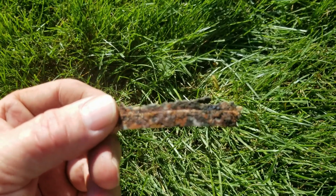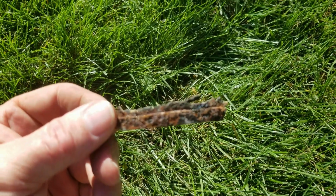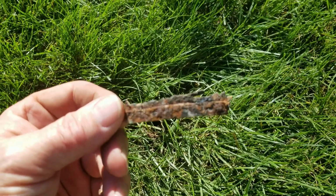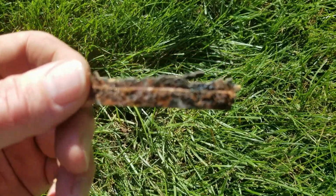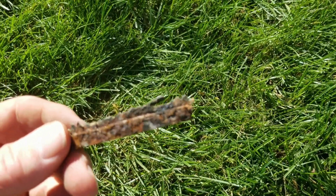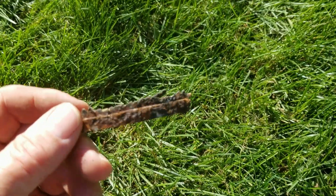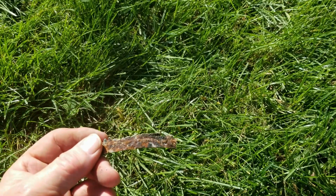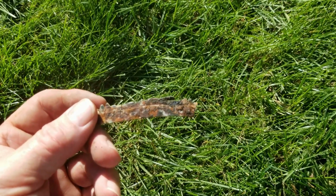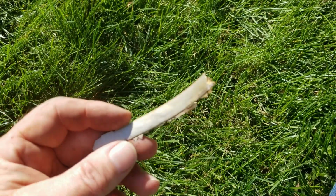I'm going to get a little pressure blaster fired up, and we're going to blast this and make sure we get every bit of rust out. And then I might just be able to re-seam seal this. Obviously prime it, put some Por-15 on it and prime it and whatnot. But I think I might just be able to re-seam seal it and be good for the rest of the life of this van. But catching it now before it rusted through is always a good thing.